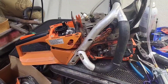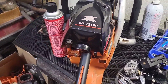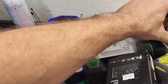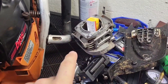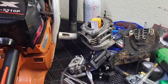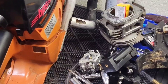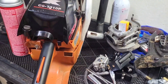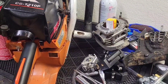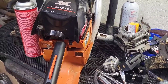I'll get y'all an update this weekend. This is Bodie's 7310 — I think I got it figured out. I'm gonna put his cylinder back on it because I tried it with a fresh cylinder and I tried it with a different carburetor. I think it's the carburetor. So if I run it later and there's no acting up and it runs great with his cylinder, then we'll know for sure it's a carburetor and not an issue on the crank or case side of the engine.